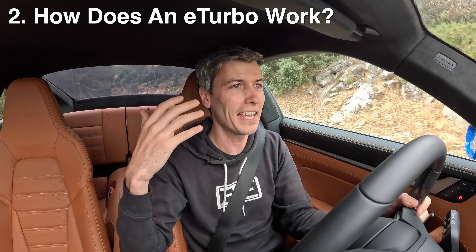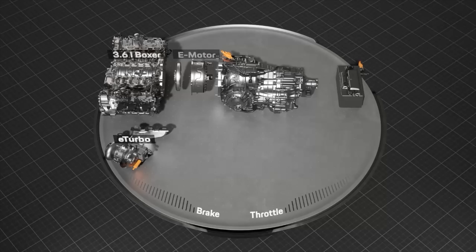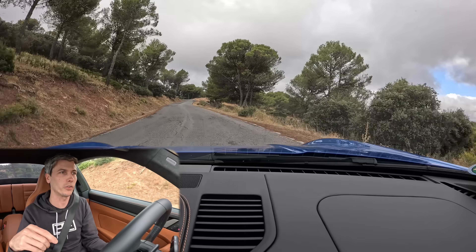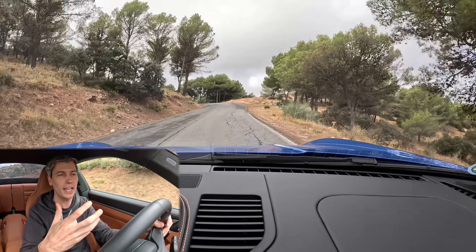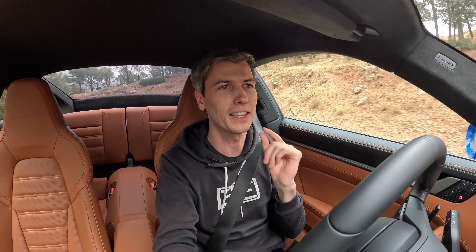So how does it work? Typically those exhaust gases spin up that turbine and you spool up, you get more boost. Well now instead of relying purely on those exhaust gases, you have a battery that can send power to the electric motor, and that electric motor can spin up your turbocharger without needing any exhaust gases. So you can get to your peak desired boost level without the exhaust. Then once you reach that desired boost level, you're creating a lot of exhaust and that exhaust takes over. You only really need the electric portion to help spin it up for a very brief moment right at the beginning when you're trying to get to your target torque level.